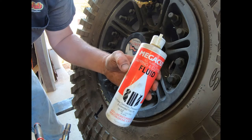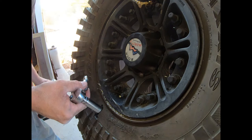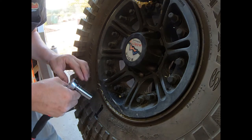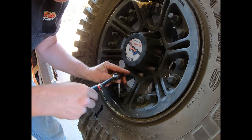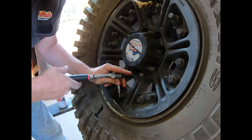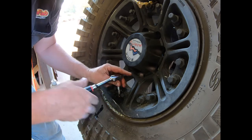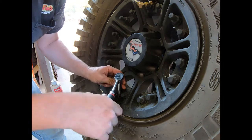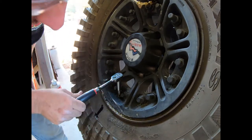This is a good industrial cutting and tapping fluid. Your better suppliers will have it, but even stuff from Home Depot will work as a tapping fluid. Tapping is all about feel, and the deeper you go, the less you do at a time. Once I'm this deep, I'll literally do a quarter turn and then back it up, then another quarter turn and back it up. It's a slow process. When it feels like it's getting hard, stop — you're going to break something, just like tapping in a bolt.